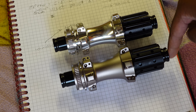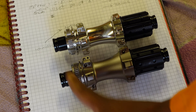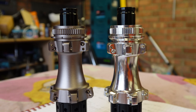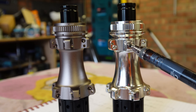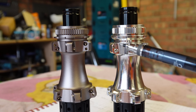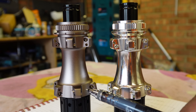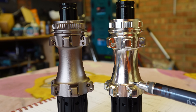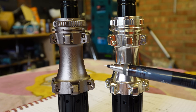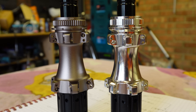The dimension from one side to the other — the OLD — is the same. The position of the disc brake is the same, and the position of the freehub is the same. However, the non-drive flanges sit about four millimetres differently, so one has a wider bearing separation. The distance between the bearing and the flange is wider on the 9velo, and that results in a stiffer wheel. By itself it probably doesn't add up to much, but these features incrementally add up and you get the full performance gain.